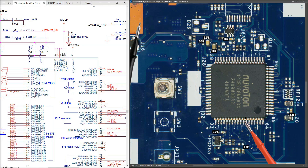I checked around the rest of the capacitors in the area of the Super I/O chip and found 1.8V on this capacitor, 3.3V on this one, 3.3V on these, and 3.3V on this capacitor here. The main point is I'm not measuring any shorts anywhere around this Super I/O, so I think it's okay. I'm going to move on to checking the rest of our secondary voltage rails.